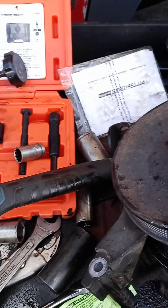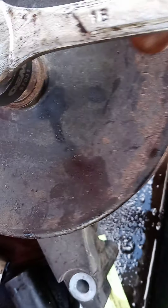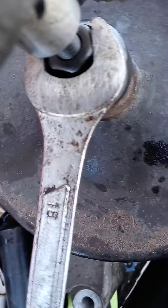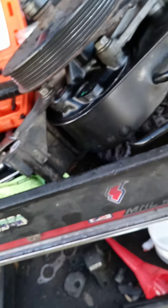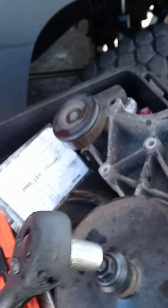So once you get the pump back on the bracket, I'm going to take this tool here with a little nut on it — 57031 — and screw this down into the pump. Put this down in, and then you want to get a 16mm wrench or socket. I believe this is an 18mm bolt here — or 17, must be an 18. And yes, this is a 15 millimeter. So you want to get your ratchet and socket and basically just keep squeezing them together until it goes all the way down and bottoms out on the shaft.